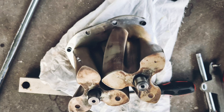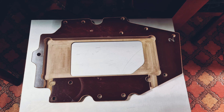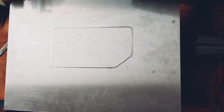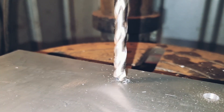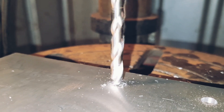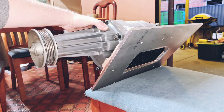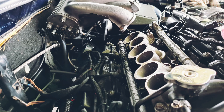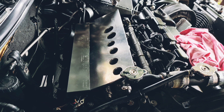Here you can see I've got an M90 supercharger off a 3.8 litre V6 Holden. What we're going to do is make a new manifold for the intake that supports the supercharger. I'm going to bolt that all up with the bypass valve, and we're going to let this handle the air for the down-low boost, just so we don't have to experience as much lag before the actual boost kicks in.